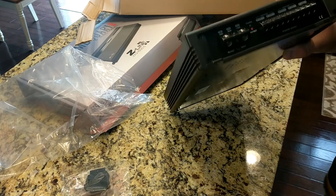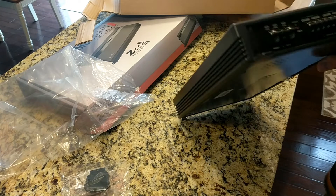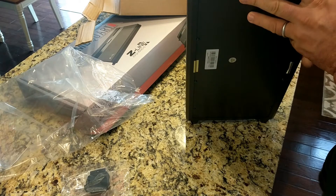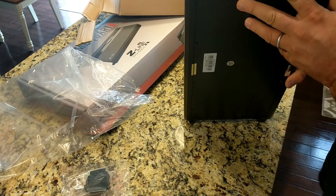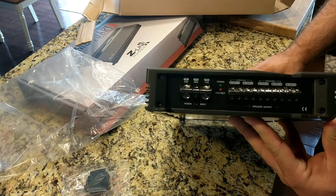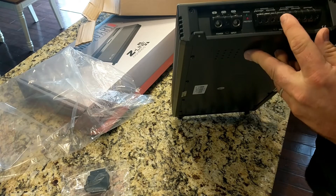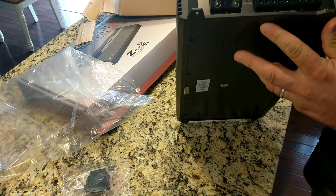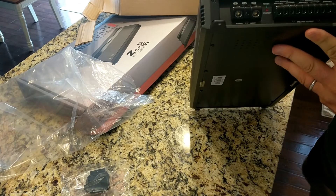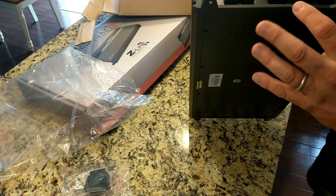The terminals don't look bad. Maybe I can use the Allen keys I got with the Belva on this one, because this one doesn't seem to come with those Allen keys. A couple of 4-gauge inputs. I don't think those are 8-gauge speaker inputs — those might be 10-gauge. But they're nice, clean-looking right in here. They're not a pain in the ass stacked ones like you'll see. That's one thing I had with the DD Audio D5.1000 before in my truck — the terminals were stacked up high and it really was a pain hooking that thing up, especially when it's installed and you've got to move wires around. This is going to be significantly easier.